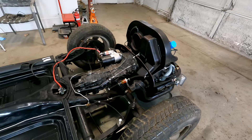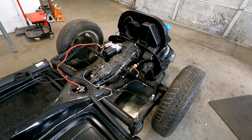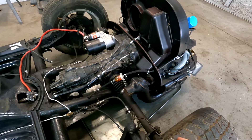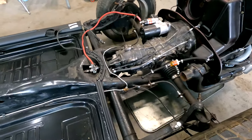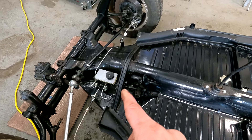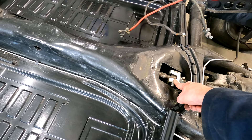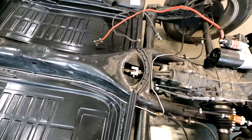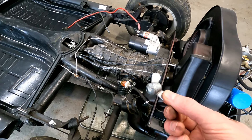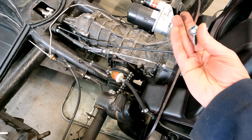We got the doghouse fan on and as you can see it ran really great. For the bonus update: it's been a while since we've looked at the back of the car or the pan, and there's quite a bit of work done. I got the fuel line hooked up, correctly angled the transaxle boots, replaced the brake line to make sure I had enough room around the pedals, and replaced the shift bushing which was completely shot — that bolt was actually seized in there so it was a long project.